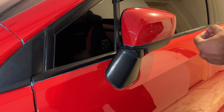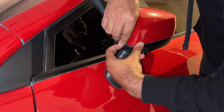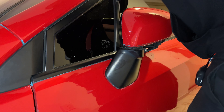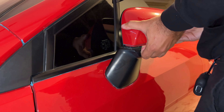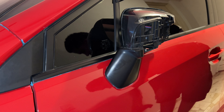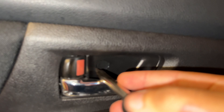Let's look for a small flathead — this one's not small but let's see if I can go with it. Starting from the back here, slide the top, gotta hold it and apply even pressure. It pops right off — sounds like it broke but nope it didn't. Now we've got to take the door panel off; there's a screw right in there and a middle one here, so we need to pop this little cover off.